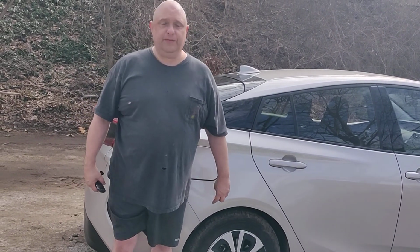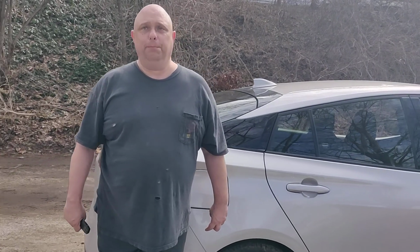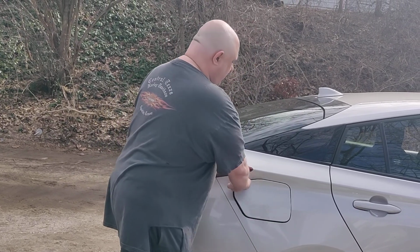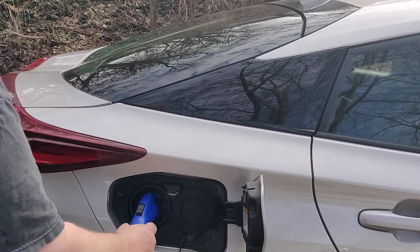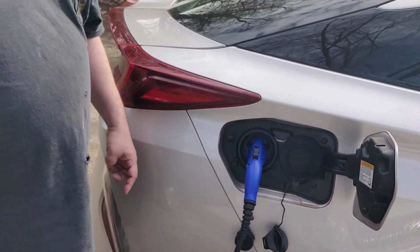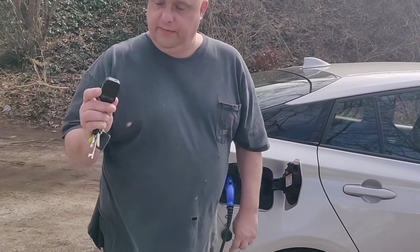Okay, so in this video we're going to demonstrate how my invention improves the Prius Prime plug-in features for remote starting. So first of all, if you're using a third-party remote like CompuStar or anybody else's, and you plug it in, which is what we're going to do now, pop that in there. Okay, the very act of doing that, you see the little green light came on, so it's not staying on because my battery is fully charged, but the fact that the plug is in basically messes these guys up pretty bad.